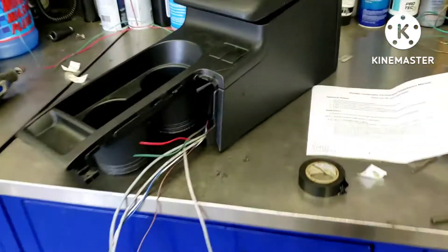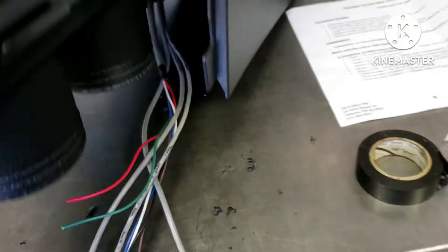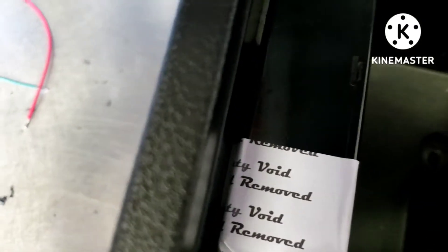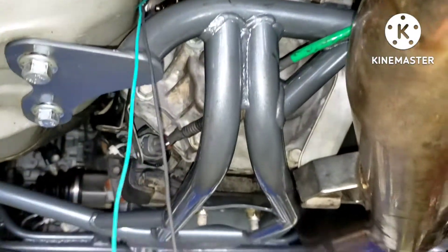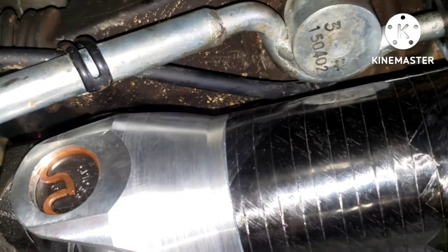It barely fit but I got it in — the wires look pulled hard but they're thin and bend pretty easy. I put a little tape on the heater hose so it doesn't move. Since it's Velcroed on, I can pull it off to get to that lower bolt — no big deal. Underneath the car there are two DCCD wires — black and green — and I had matching black and green wire to solder to them. I'm going to zip tie it to the reverse lockout and then run it through the grommet, keeping it well clear of the driveshaft.